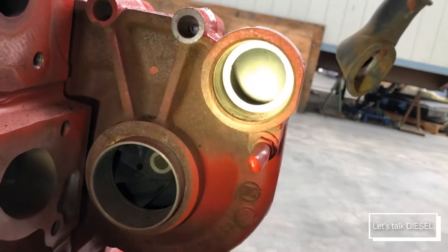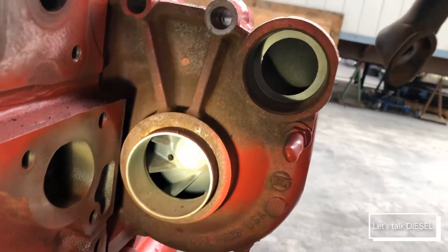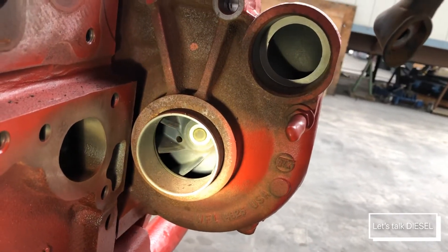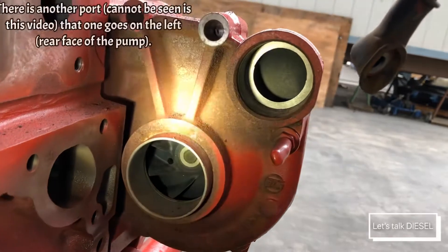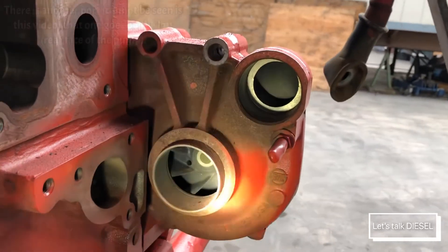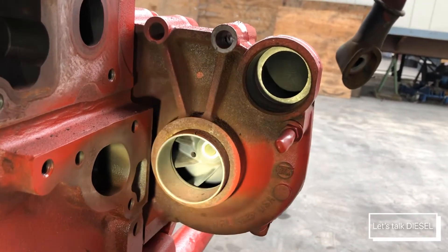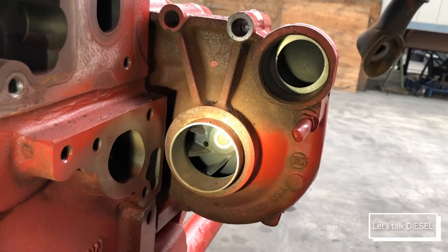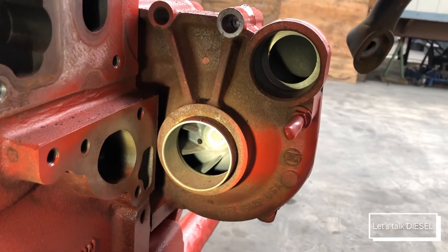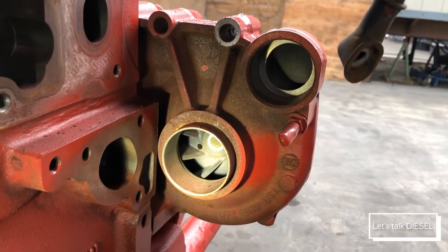That's the main part that makes your coolant flow around. You have one single hole in this water pump — that's the one that could be the suction side or it could be the pressure side generated from the propeller. As I said before, if you see any stain around the coolant pump, it means it's time to replace it, or you have to fix the gaskets or O-rings, whatever comes with your coolant pump.